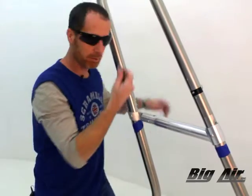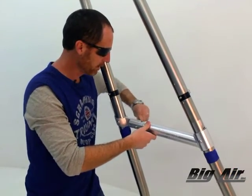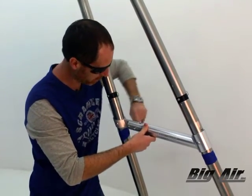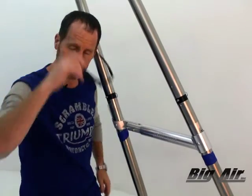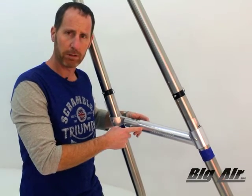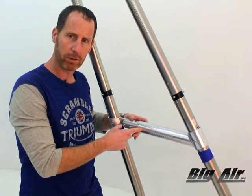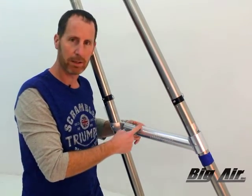I did pre-drill it some. This is our stainless pin — it'll slide in here. Sometimes they take a little bit of work to get through. I'll finish up tapping by hand. Sometimes you have to chase them a few times to clean them up and make them flow easily. The last thing I'll do is drill the final hole on the boat so I get the proper stretch on the tower and the proper alignment.